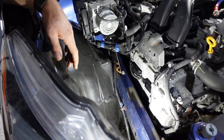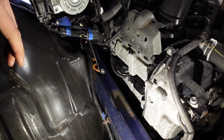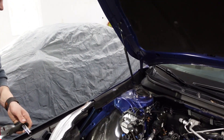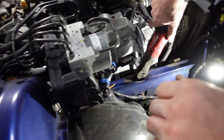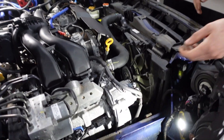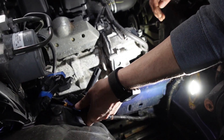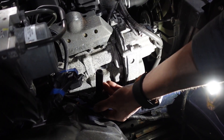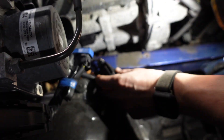We've got a couple of 10mm bolts holding the coils in. Let's do one at a time — let's shoot for the front one. I got the coil bolt. See how the coils pull off — nice. We'll just set the coil aside. I'm going to look inside here and see how everything looks — I don't see any corrosion or anything like that. I'm happy about that.